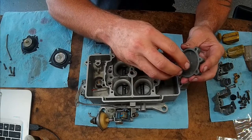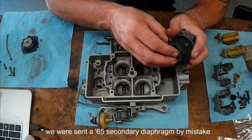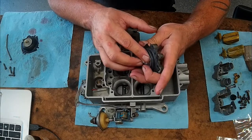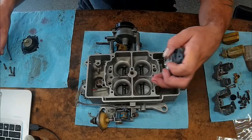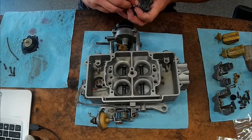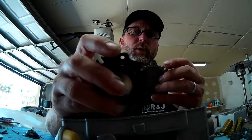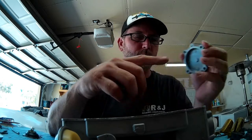Your spring goes on the outside of your cover on the back side of your diaphragm. Hook your pin over your lever arm. As long as you've ordered the right part, install that with your four screws into the body of your carburetor. Similar to the primary, the only thing to make sure you get right is that the hole here in the diaphragm needs to line up with the hole in your cover. New secondary diaphragm — the proper one — is now on the way.